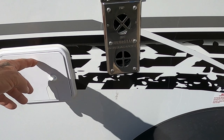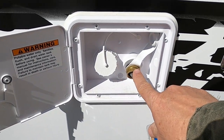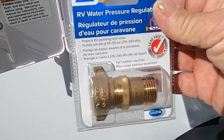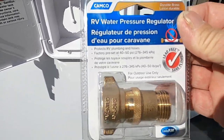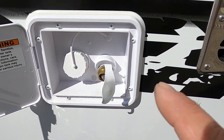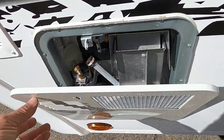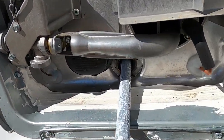Now let's check up our water. The docking station is here — to the left of our heater flue. On the right is going to be our city water; over here is going to be our fresh water. At campsites we're hooking up the city water connection. First and foremost, use your water pressure regulator — this is going to reduce the water pressure to 40 to 50 PSI, protecting the lines in your unit. Always use these. Then hook up your hose but don't turn it on yet. Right there is your hot water heater — make sure our drain plug is back on.